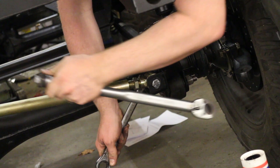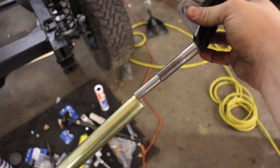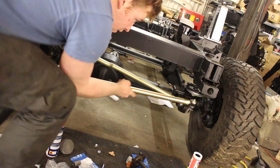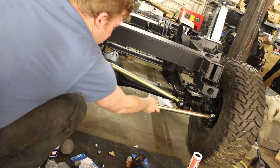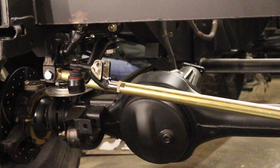The cross rod eye needs to go into the steering arm. This is a left-hand thread, so it fastens by going counter-clockwise — that's set up so that when you adjust it and twist the steering arm, both sides extend or retract together. Put that in place. There are castellated nuts and split pins to go in, but I'm offering it up loosely for now so I can fit the steering damper.